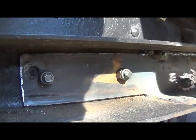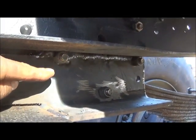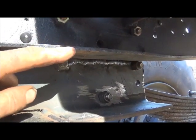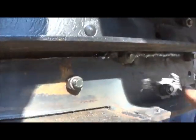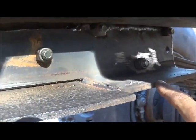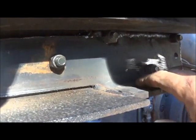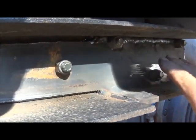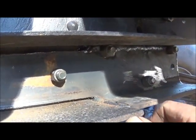Okay folks, I've got one side done here. You can see I bolted it in here — I've got it welded in, but I just welded it to the outer plate, I didn't weld it to the mainframe. I did weld it through here, and then on the bottom, the only thing bad about using this thick of frame is the radius is different. Because a thicker frame takes more of a radius to get the bend, so the radiuses don't match up, but that's not that big of a deal.